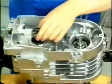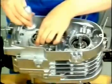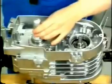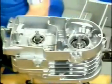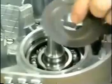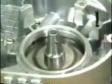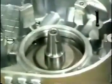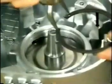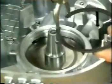Insert the lay shaft bearing with heated up inner race to its stop. Install the oil guide disc and circlip in a way to ensure that punch mark and open ends are facing the oil bore.